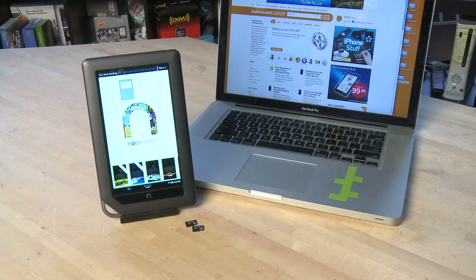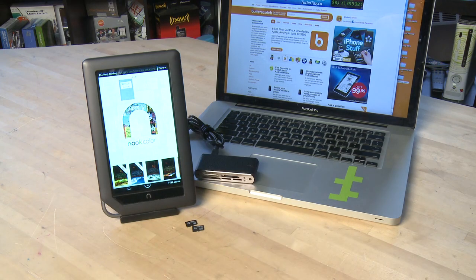You'll need Deeper Blue's NookHoney04 image file. You can get that at bscotch.tv/nookhoney — that's free. You'll also need one Windows or Mac computer, which we presume you already have, and one microSD card reader, or an SD card reader and microSD card adapter. Word to the wise: while you can do this hack with a 4GB card, you'd be advised to grab at least an 8GB card if you intend to put the Android Market on the device and in turn download some apps.